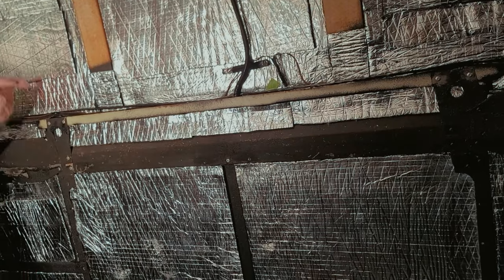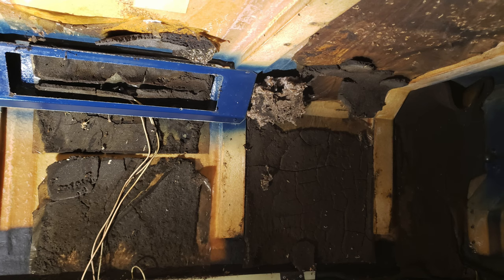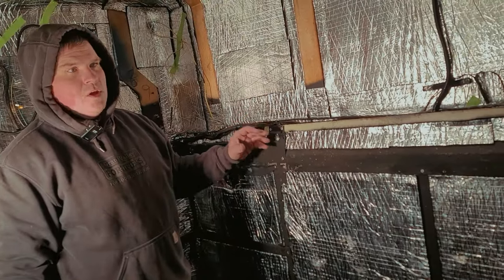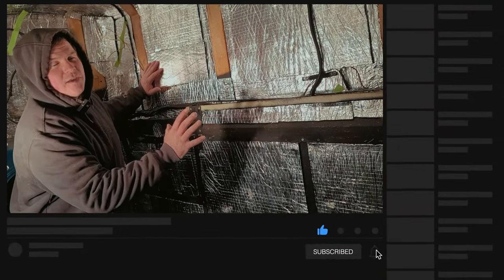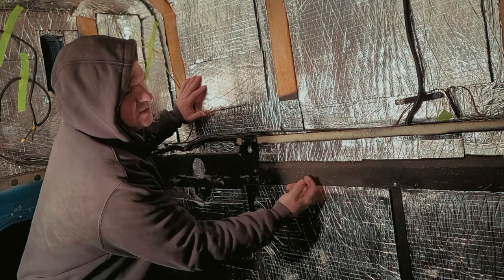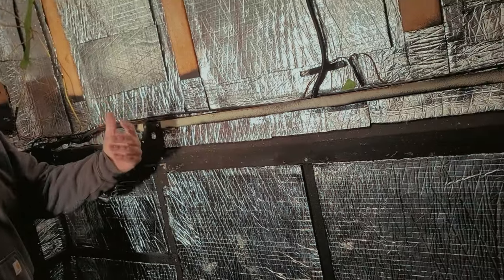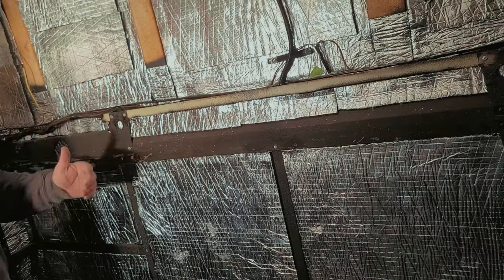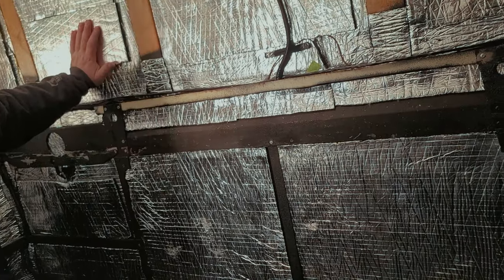They covered 75% of the area maximum. Using thinner 10 mil material versus going to a one-inch foam — what was cool is you could slide stuff up in here, stick the first layer everywhere, and then just leave the backing on your second layer and slide it up in behind pieces. That let you fill inside of tight spots a lot easier with the thinner layers.